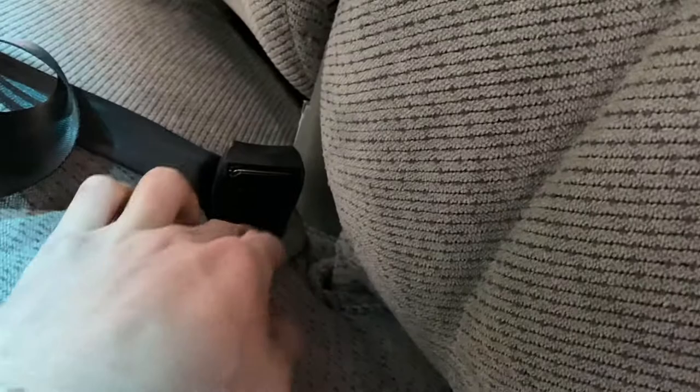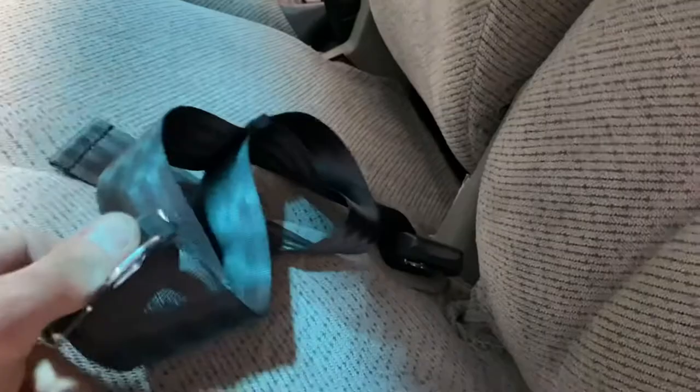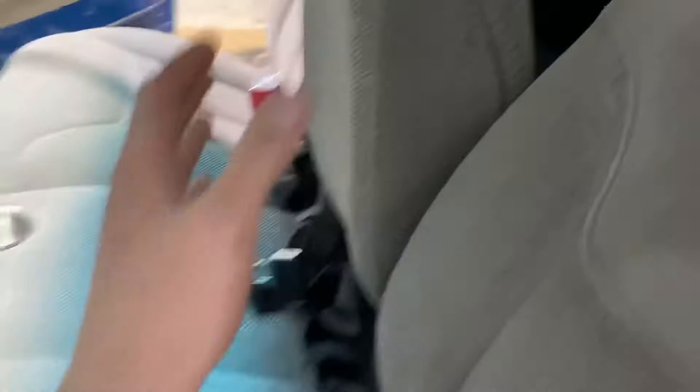Just like that, the seat is all in and the seat belts are hooked up. Got the shoulder belt over here and then we have the lap belt under here coming through this hole. This buckle is actually just long enough to fit in here — it has a plastic holder so that it stays upright and doesn't fall in the crack, but on this side that plastic piece wouldn't fit through the hole so I had to pull the plastic piece off — it's just the buckle and the belt — and then bolt it down to the bracket behind the seat. Both fit through the hole perfectly. One thing to note: this middle seat actually hits the sub box I made when it goes up. If you slide the seat all the way forward you can get the middle seat to fold all the way back, then slide the seat right back, but you can't move the seat where you want it when this is all the way back. I didn't really plan for that when I built the box, but I'm glad I can still figure out a way to flip it up.